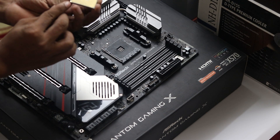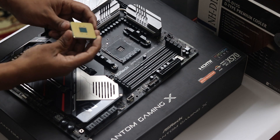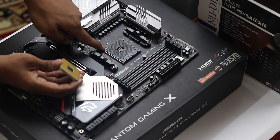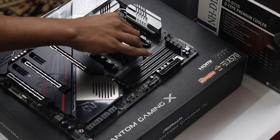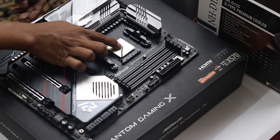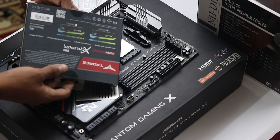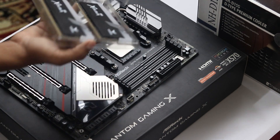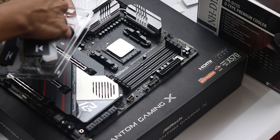On this side we have the golden triangle on our motherboard, and we can install the CPU by aligning the CPU's golden triangle to match it. That's it for CPU installation. Next up is RAM installation — for the best performance on Ryzen, you want a dual channel configuration, so we will use the correct RAM slots for dual channel, which is very important.